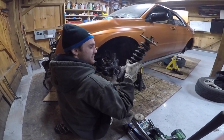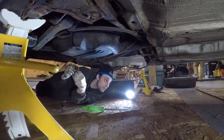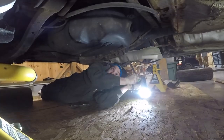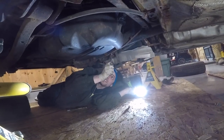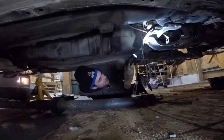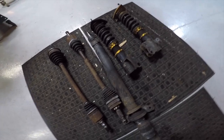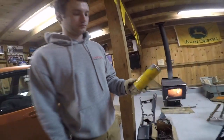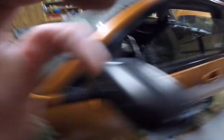First coilover out. As you can see there's not really any damage from the accident or anything. We got the coilovers out, we are getting the axles out up front, the driveshaft out — four bolts on the diff and there's a cover I had to get off. We got all the shafts out of this thing. Front axles, driveshaft, front coilovers are out. We got our Red Bull. The only thing left is I got to disconnect the shifter.